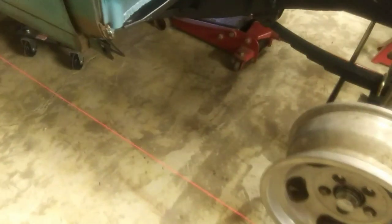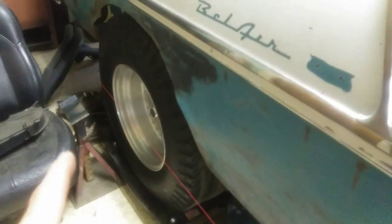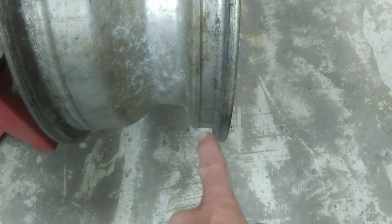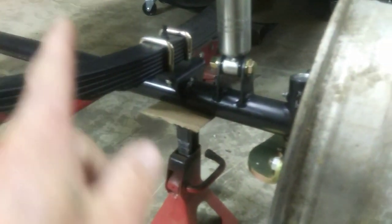So I've been doing the alignment on this '55. I've got a string tied around the spring and dragged it out around the back wheel just to touch the sidewall of that tire. I measured from the rim to the string — the outside string is 3 and 5/8ths. I did the same thing in the back, hooked the tape measure on the front of the rim. It was 67 and 5/8ths front and back. So now I got three wheels that are true to each other.